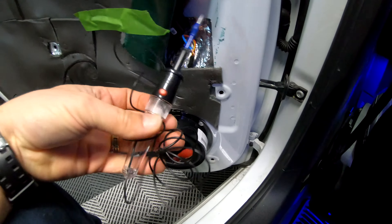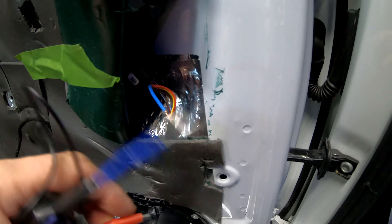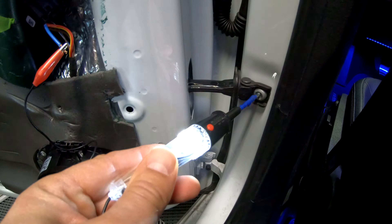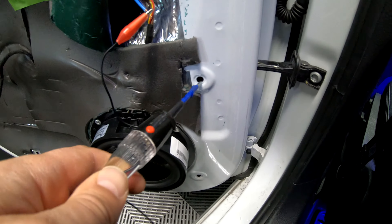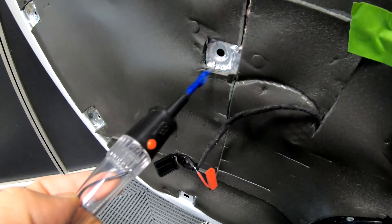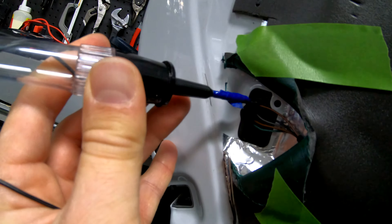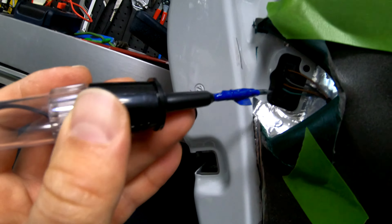You need one of these LED testers. I have the positive wire coming right out from the positive, and I'm going to connect it here. Every time you touch a wire to ground, this bulb should turn on — there you go, that means I have ground. If you touch it to painted metal, the paint protection sometimes won't make a connection, so you might see less consistent results. You're going to touch every single wire one by one to check for 12 volts.